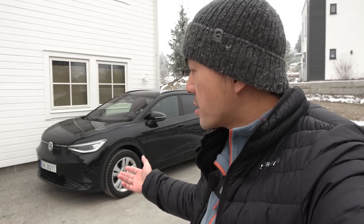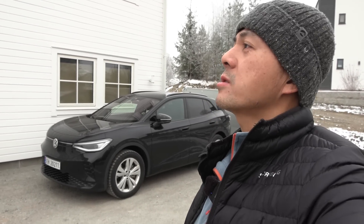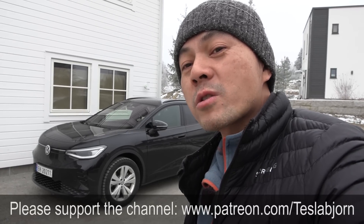Now we can see the difference between the Kona and the ID.4. Different Hyundais with different battery chemistries might do things differently. Even around zero degrees Celsius, if you soak it long enough, you'll see these effects. It would be interesting to retest what Tesla is doing, and check Audi and other brands in the cold. The Kona suffered poor efficiency by cycling the battery heater, while Volkswagen chose to just charge slower. So the question is: do you want the best efficiency, or do you want the best charging speed? I hope you enjoyed this video — thanks for watching.